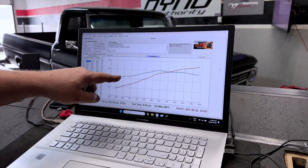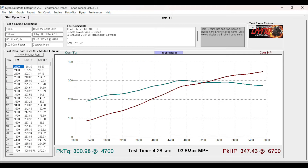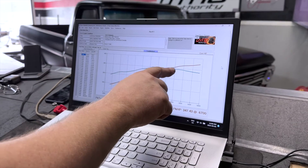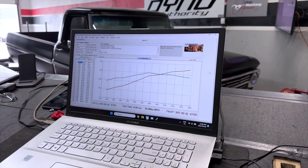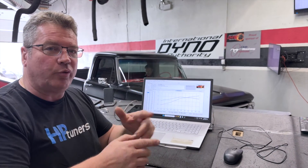You can see it's like a spaghetti noodle — really weak. It's running fine but it's not making any serious torque on acceleration. The horsepower goes up nicely but it doesn't really do anything until after 5,600 RPM. Nobody wants to drive their F-100 at 5,600 RPM, so we're slowly working through the bottom end tuning.